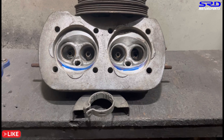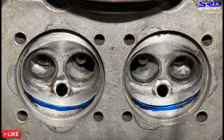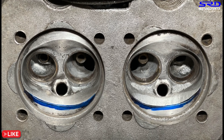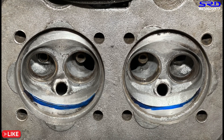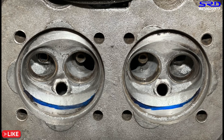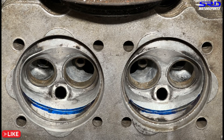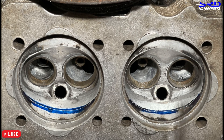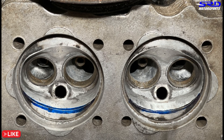Here we are on the porting bench. We're starting with a carbide bit just so it won't take too long — if you go straight to 80 grit it takes forever. We're lowering it bit by bit to keep it consistent. Then later we'll make a pass with 80 grit then 120 grit. Now switching to the other head — also lowering it based on the same one pattern, so all four chambers are going to be equally the same shape.